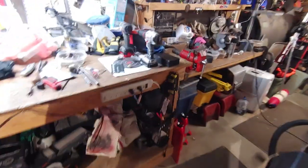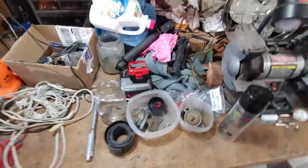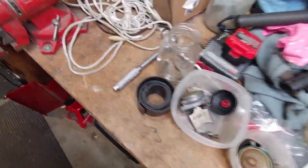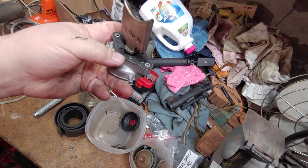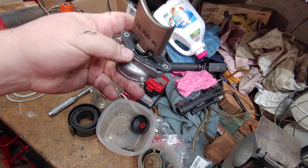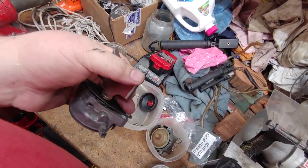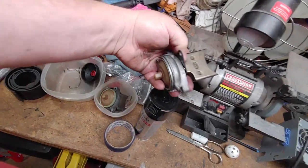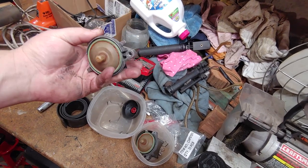The RAVE valves, where are they? My RAVE valves here. I don't have to replace the gaskets on it, because these are new gaskets I got a couple years ago, and they're a very thick rubber, so they're fine. But you get carbon buildup on these in the corners and on the top. So I just take a wire brush wheel and clean these off so they'll slide nicely.